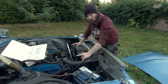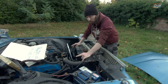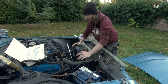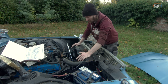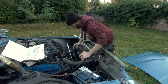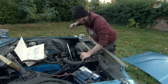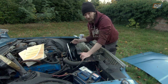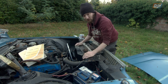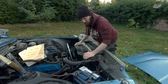Mechanically though we'd like to do one more quick check first. Just over a year ago I managed to snap a valve, bend another one, and poke a big hole in my piston in the Rover by trying to start the engine when it was out of time. So to make sure we don't hurt anything, we're going to turn the engine around a full two revolutions and make sure it goes free with no crunching, grinding, or impacts - and then if that works we'll give it a quick flick and make sure the starter runs.